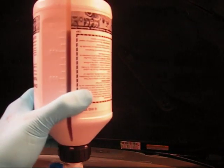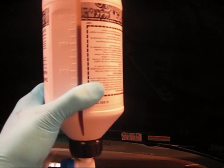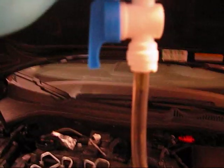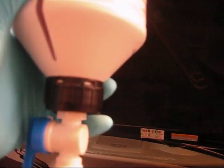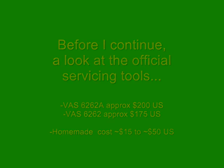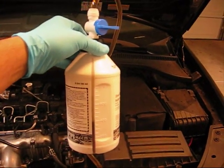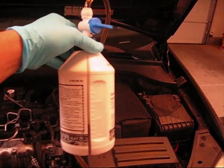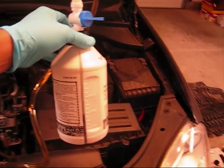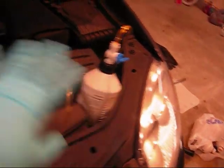There are two versions of the official tool — the one without a suffix and the one with suffix A. The one with suffix A allows for a tube to come out and sit just slightly higher than the top of the bottle, so that air is always coming in and filling inside the bottle. Once I've got the sixth bottle — the sixth liter — about halfway done, I would have put in about five and a half liters into the transmission, so I close the valve and set it aside.